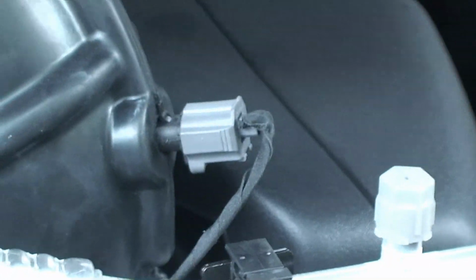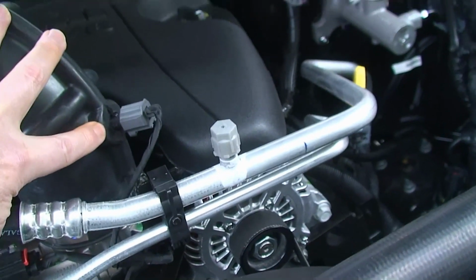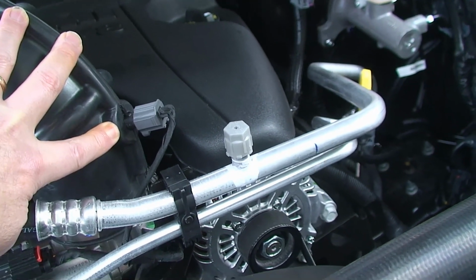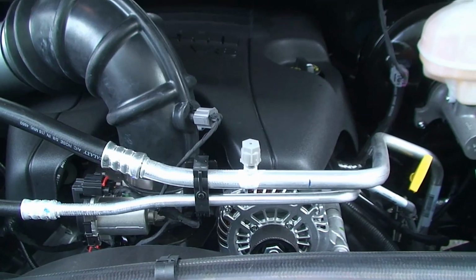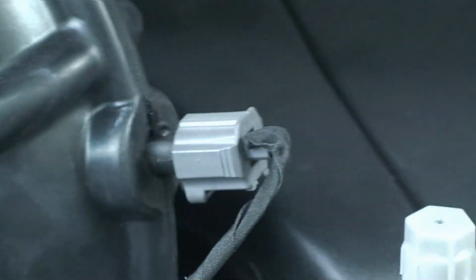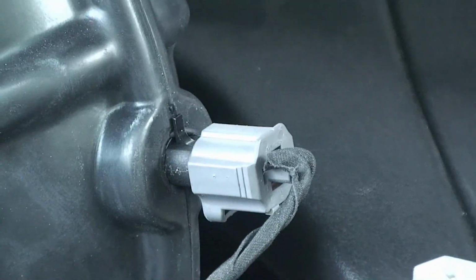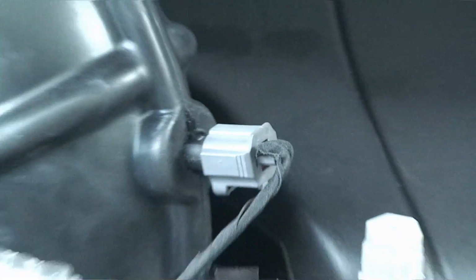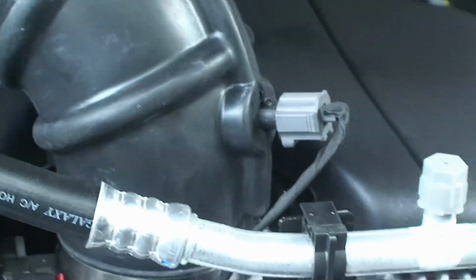And the problem is that this tube here is a lot thicker than the old one. And this entry hole, I think during manufacturing it collapses and gets a little too small. So the air intake didn't want to fit in comfortably. So what I had to do was ream it out, and I had some large drill bits, and I started small and progressively reamed it out so that it would get bigger and bigger until I was comfortable with the way the air sensor fit in. Obviously at each step making sure to clean out any rubber bits so that they don't get into the air intake.